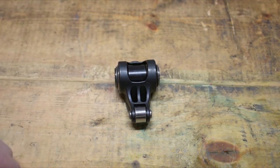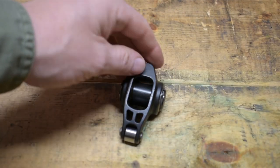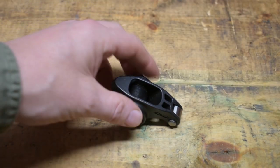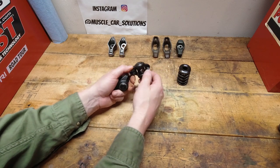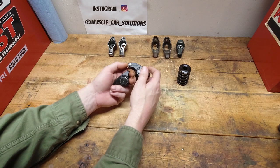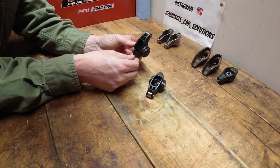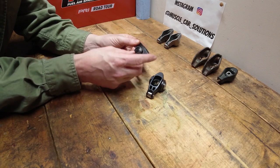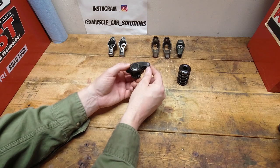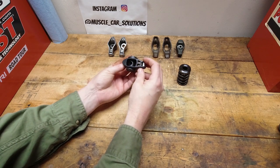The needle bearings on the trunnions are very well designed and take a heck of a lot of abuse. These are what I use in the big block and in my LS every time I can use this rocker arm. They're very reasonably priced — not going to price you out of the ballpark for a steel material type rocker arm. This is easily my favorite out of all of them — the best design out there and certainly the best value. There is a lifetime warranty on these rocker arms, which is how confident Comp is in them because they will take an awful lot of abuse and keep on going.